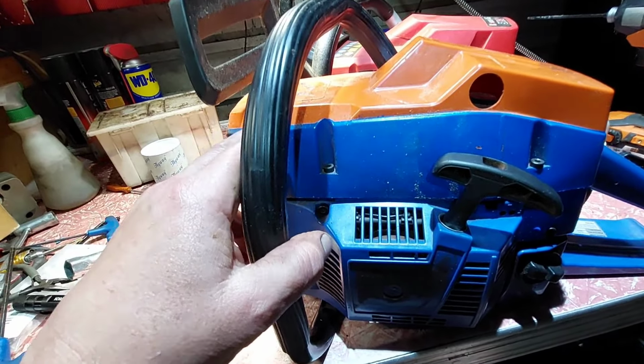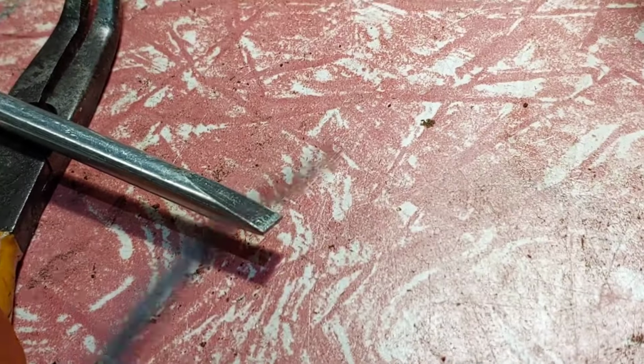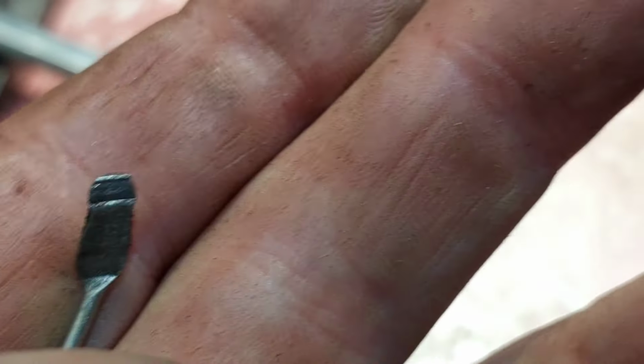But I started checking either side of the piston, and either side was fine. But the back side of the cylinder, I should say, I put the wire solder back through the back of that cylinder. It's very thin. That squish on that, it's 21 thou. Very thin. I never thought about that, but I thought I better check. But yeah, no good, so I can't do squish on that.